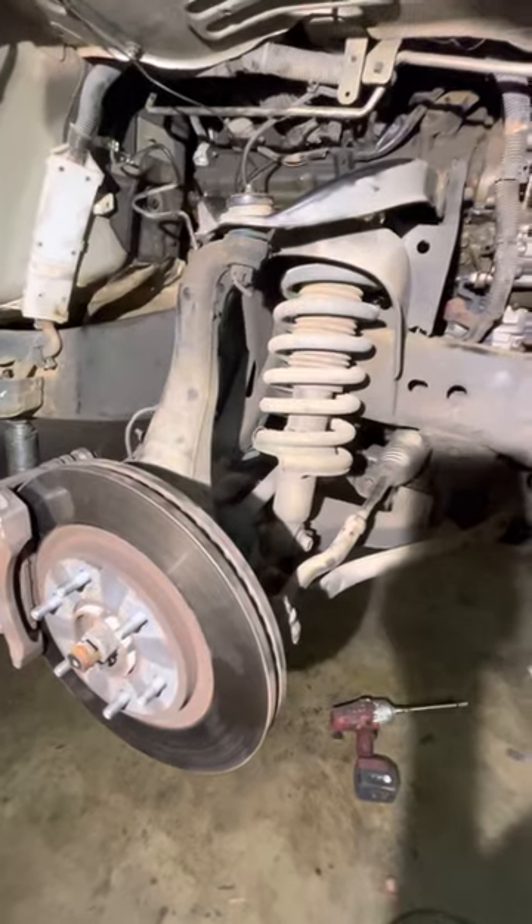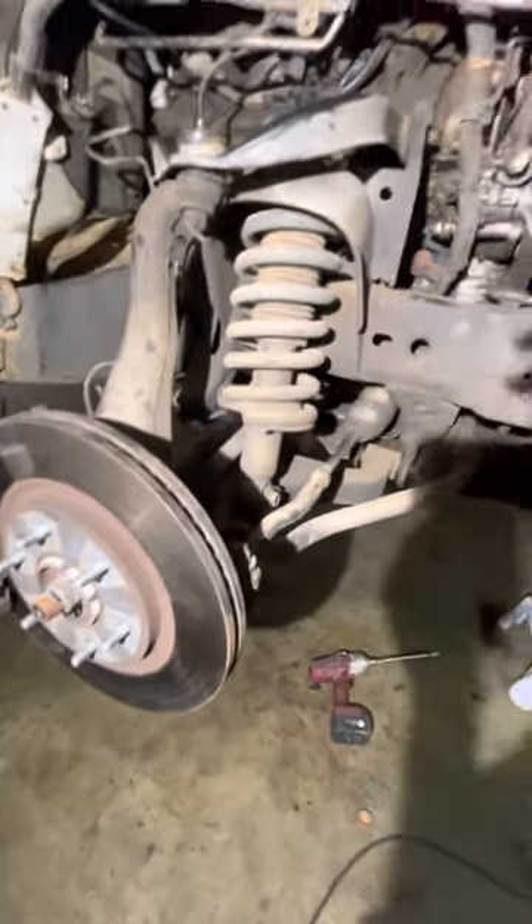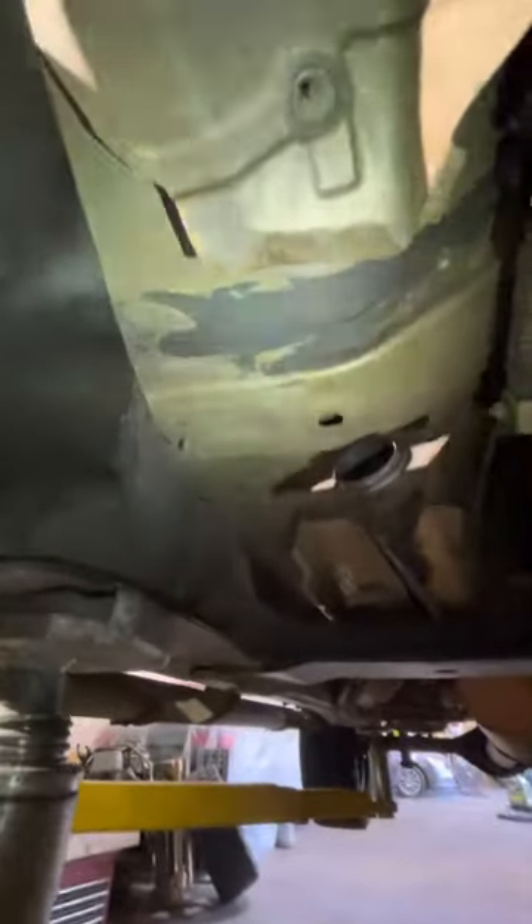This is a four-wheel drive and I was still able to fairly easily get it out. I took this black cover off, and then I went down here — as you can see, I took this Y-pipe off. This is the secondary catalytic converter for the left side. I took that Y-pipe off first so I could create space for the main catalytic converter.